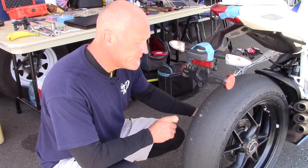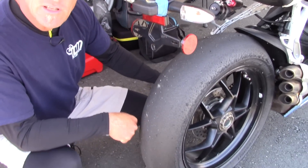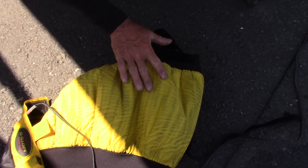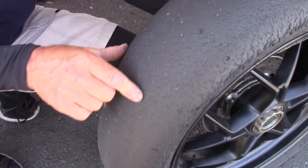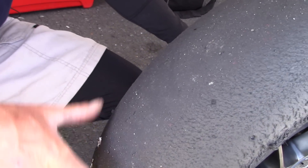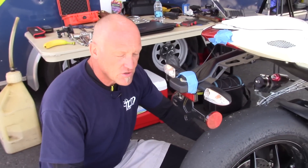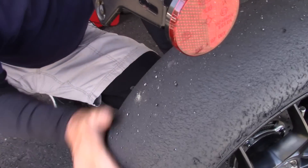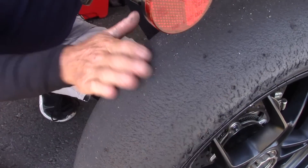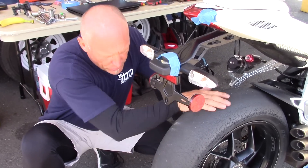It's lunchtime; we need to put this back on the warmers. A lot of people put the warmers right back on — but you've got exposed electrical elements here that run across the tire. These need to impact and touch the tire because they're full of current and heat the tire up. On the tire, we have a serious number of large rocks picked up when we left the track. Those rocks will make sure the element doesn't touch the tire, which will set the tire warmer on fire or at least burn and have the element burn through the covering. So every single time, front and rear, you come in — get some gloves, get a brush, or just use your hand — and clean the tire off to get rid of everything off the surface, ensuring that every single element sits completely flat against the tire.